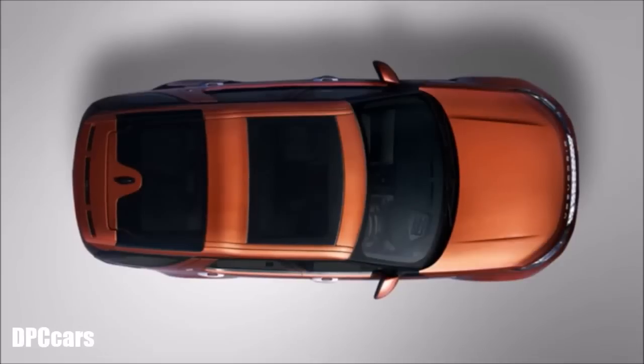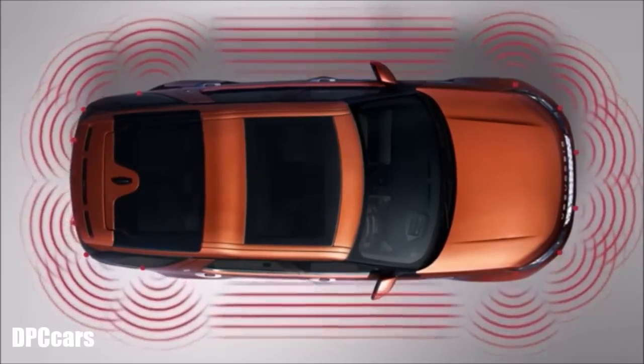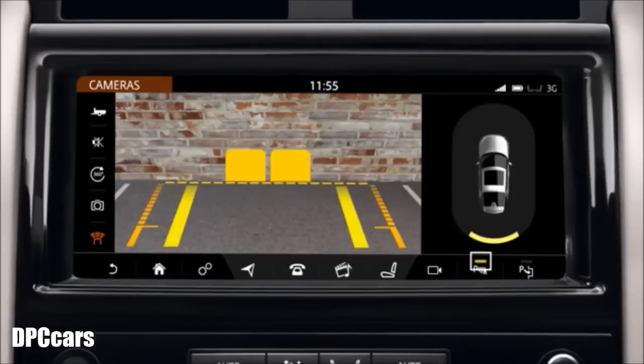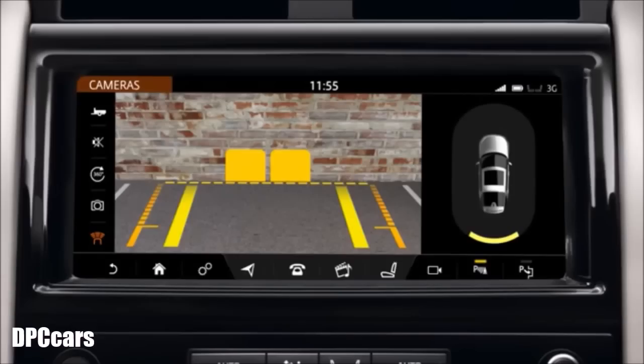When reversing into a parking space, the parking aid system automatically activates. The front, rear, and side sensors automatically activate, and the indicator above the parking aid icon illuminates to confirm that the system is active. If you have an accessory fitted to the rear of the vehicle, it is important to remember that the system indicates the distance between an object and the bumper, not the fitted accessory.